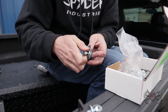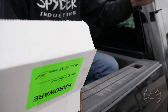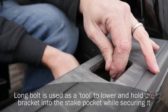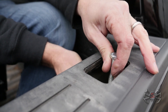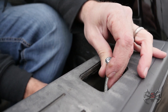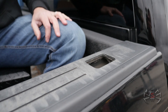We're going to take the small bolt out with the fender washer and the regular washer, and slip it down in the stake pocket. Where the hole is inside the bed, we'll put that small bolt with washer back in there, get it snug so it won't flip around down in the stake pocket, then pull the bolt back out. We'll do that on both sides.